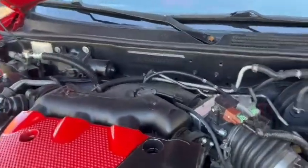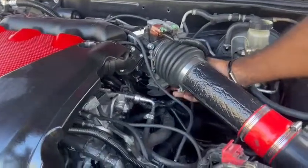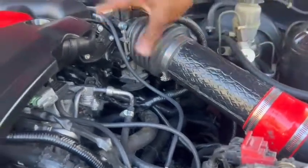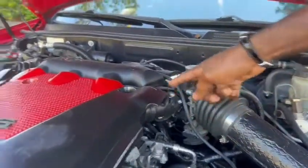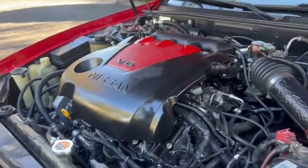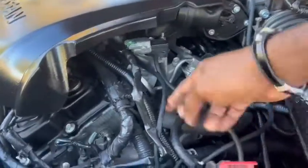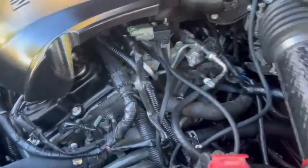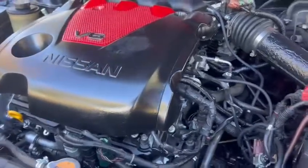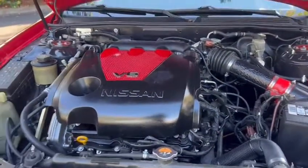Fuel pressure regulator — you know — on the side of the body. The actual receiver is at the bottom, you can see it down here. I had to flip everything upside down so that it actually fit; otherwise it'll hit on the side. Everything else is mainly plug and play. I kept both knock sensors in there — I just wired both of them together into the harness for the 3.0. Other than that, used back my 3.0 tranny.